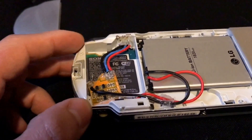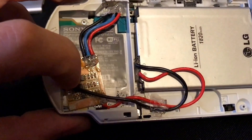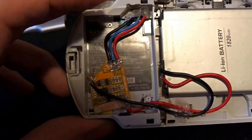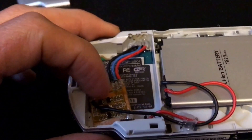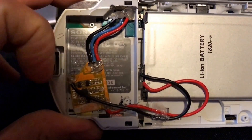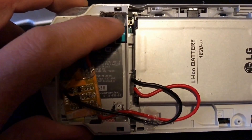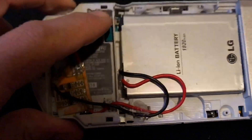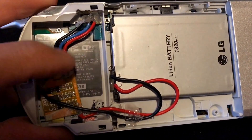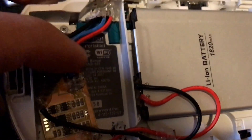You need the circuitry to charge the battery and as a pass-through for voltage, battery percentage, and stuff like that — this circuit board provides all that for the PSP. You'll need one of these circuit boards. You disassemble the battery; it's basically in two halves, sandwiched together. You just pry it open, then desolder — there's one solder joint up here where the black wire is attached and one down here where the red wire is attached. I bent the connector when I took it apart, so I just cut my losses, desoldered it, and soldered these three jumper wires.